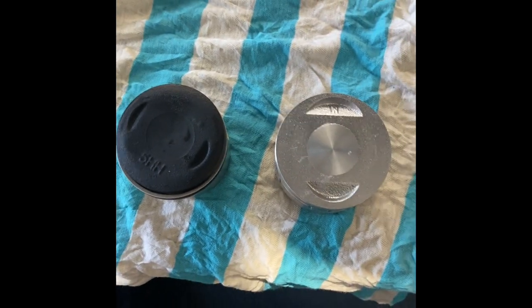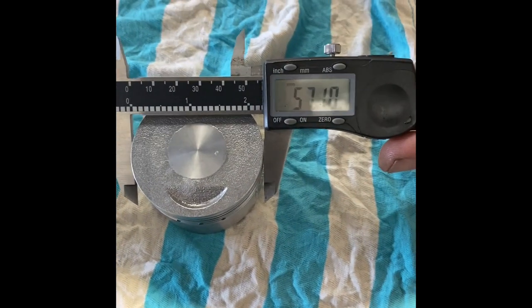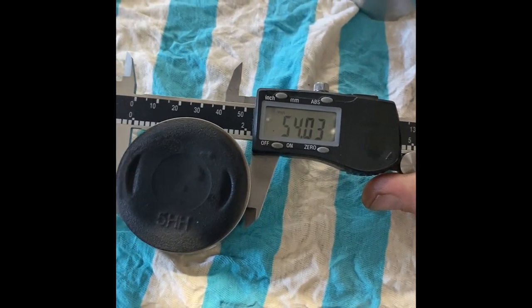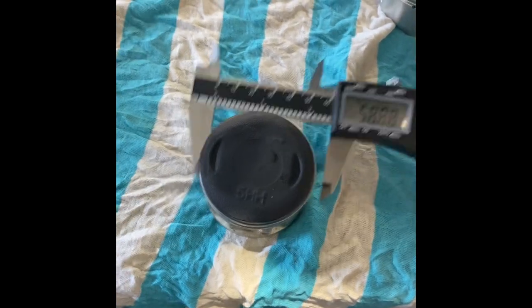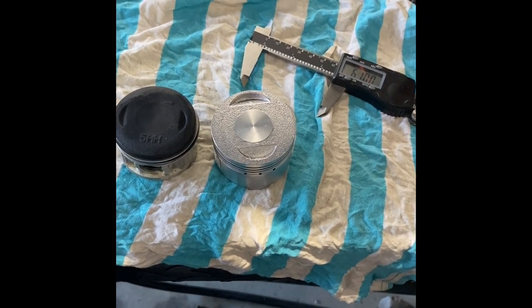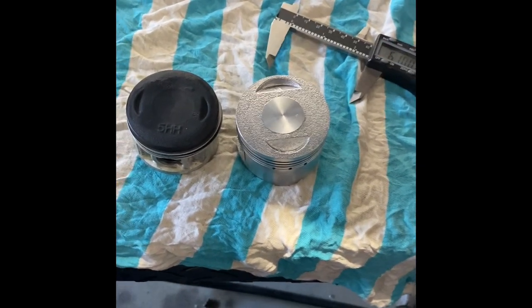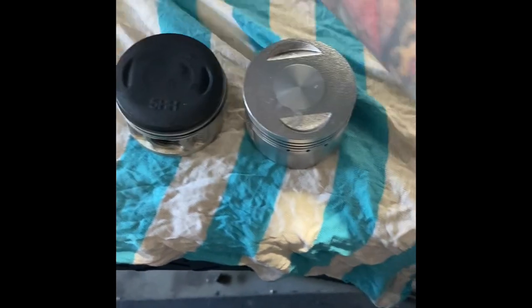Going from 125 to 150, there is obviously a distinctive size difference. As a rough rule of thumb, just to give you guys an indication, we're working with 57.10 — only rough, just to give an indication. There's a 3mm difference in sizes. So what we need to do is have an allowance of fuel difference with the carby — I'll check the pilot jet, main jet, and probably lift the needle at clip position. That's our piston difference there.